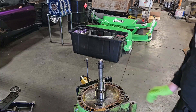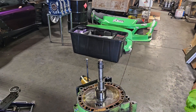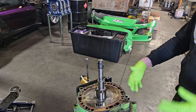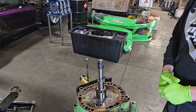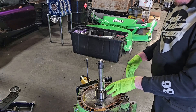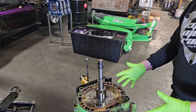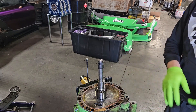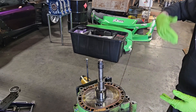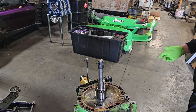The front lobe is actually pressed and keyed into position, and this actually requires a specialty tool. This is fairly unique if you compare it to piston engines — referring to the crankshaft, you very rarely ever see a multi-piece crank. The fact that Mazda was able to engineer a strong, reliable multi-piece crank is very interesting, and this design is also what led, both within Mazda and in the aftermarket, to four rotors, five rotors, and six rotors, building on this idea.